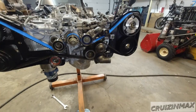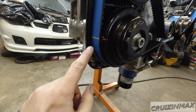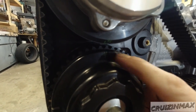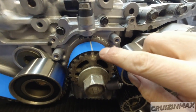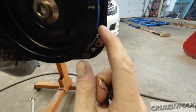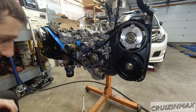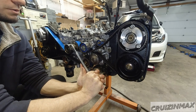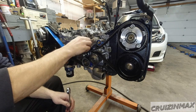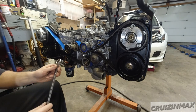Checking all the marks — one, two, three, four, five, six, and seven. Now it should be safe to spin the crank. But before you start spinning, remove the pin for the tensioner, because if you don't the belt likes to skip — it doesn't have proper tension on itself yet.